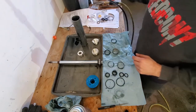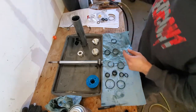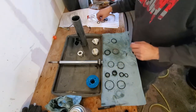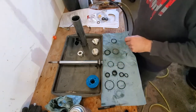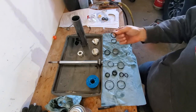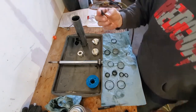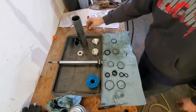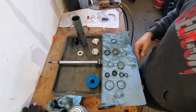There's the Schrader valve I'm going to put in. The kit is from Forged Off-Road — they're the ones that make these Schrader valves. They're a specially made valve with a little O-ring on them that threads right into that hole. There are some kits where you tap the hole out — that's completely fine, then you just put some pipe sealant on it.